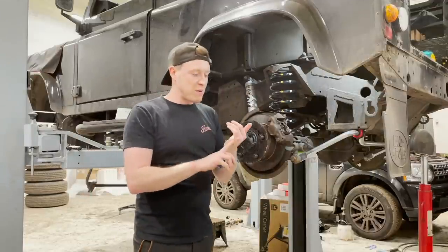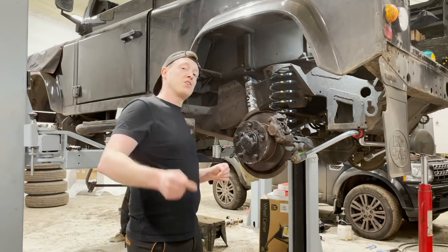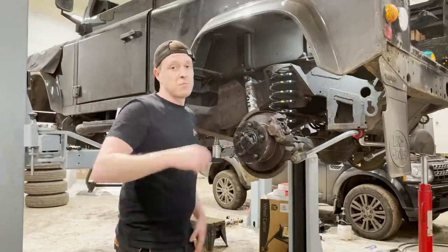And we've now done the front suspension, the rear suspension. I'm happy to say that that's all done, but I've missed out the rear arms. I'm just going to jump on those, do those now, get those new bushings in, pressing the ones on the rear and change these ones at the front here. And then we can jump to something else at the front end.